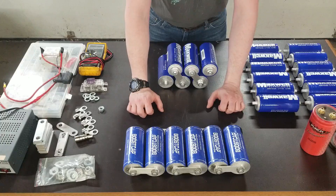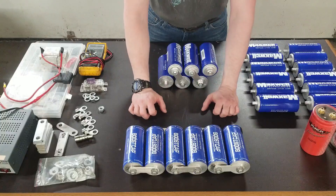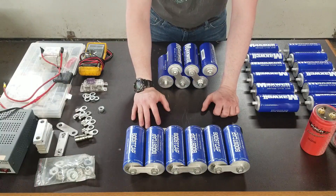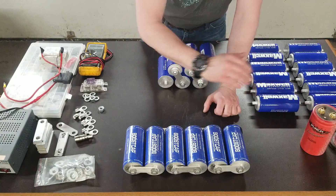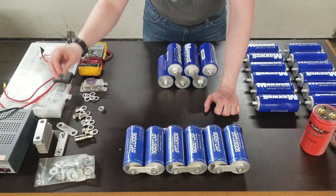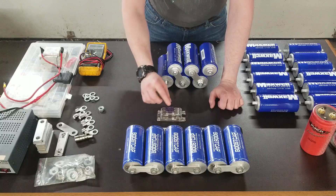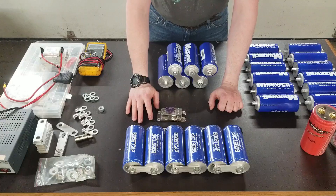You can buy these cells either used or unused. Many of the ones here I sourced from a company that used them in solar panel applications to ride through solar fluctuations. Besides the capacitors and bus bars, I like using a maxi fuse holder. A 100 amp maxi fuse has been fine for me for the last five years I've run ultracapacitors in my cars.